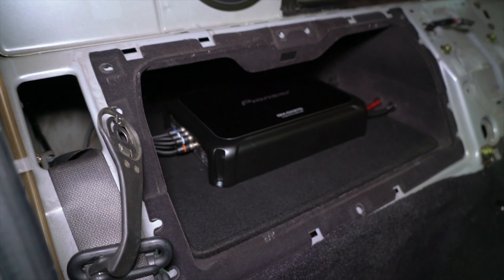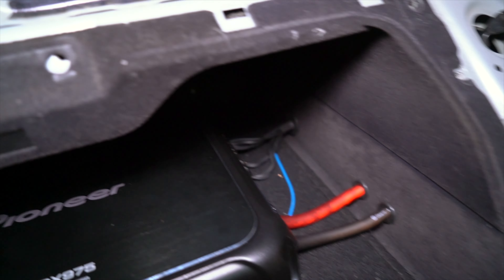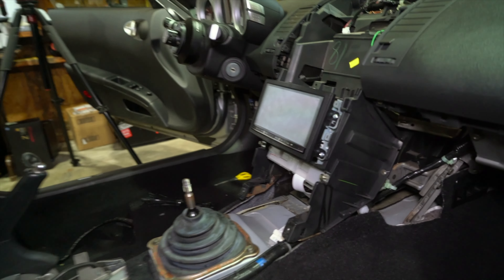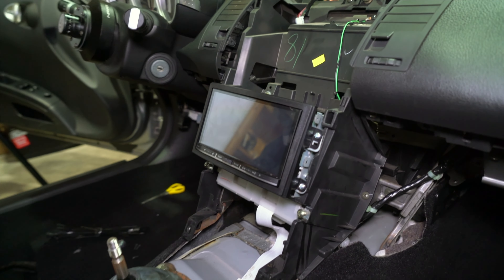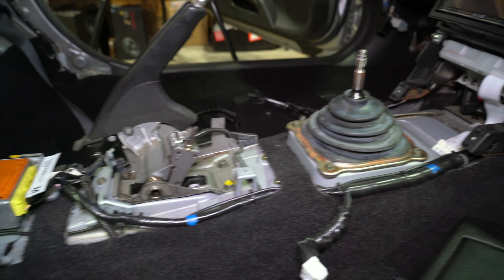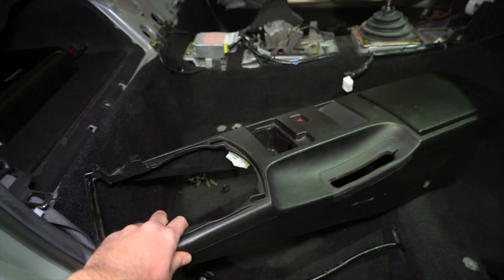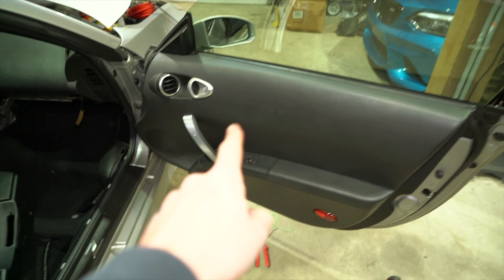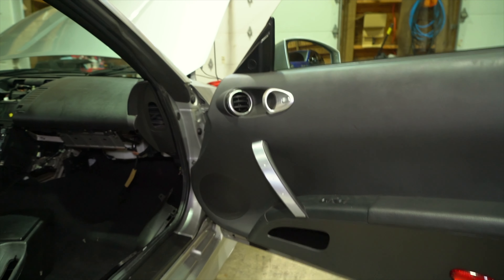Got the amp all wired up — it looks absolutely beautiful, I'm super happy with how the wiring turned out in here. Everything is run nice and cleanly. The head unit is officially mounted with the plate that closes the gap between it and the dash, all that wiring is done. I ran the cable down here that connects the USB for a phone. So we're going to go back in the car and it's time to start looking at getting the door cards off so we can replace the front speaker and tweeter and actually test this system out.